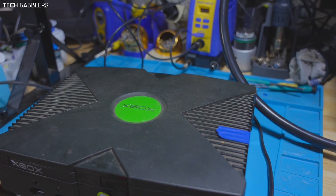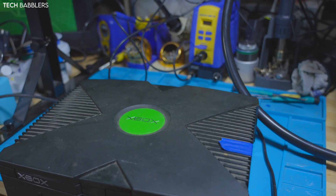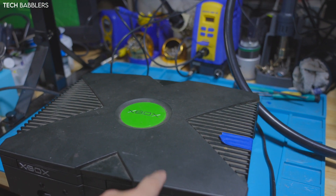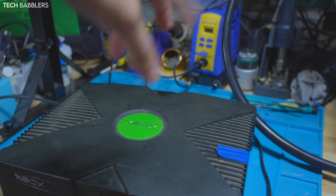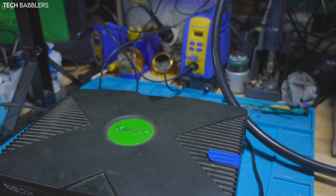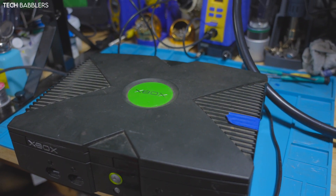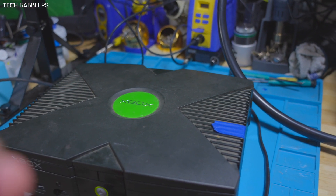For those of you that don't know, the CPU is over here — you lift it off and replace it with an Intel CPU. These guys use Intel mobile CPUs. So you put an interposer, a bunch of resistors, solder that on, and then put an Intel 1.4 gigahertz CPU. I'll leave a link to everything down below, basically on that interposer and that makes it work with the console. It's good for emulation and other stuff.